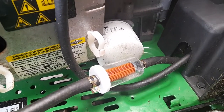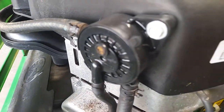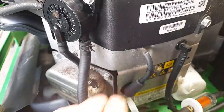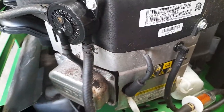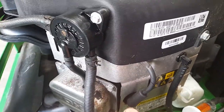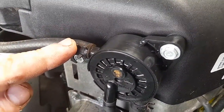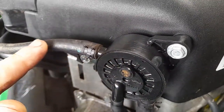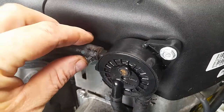In this case, we have a fuel line going up to the fuel pump. What we need to do is disconnect the line going to the carburetor, crank over your engine, and the pump will push some petrol through. Have a rag or a glass or something to catch the petrol.